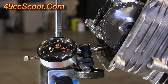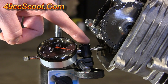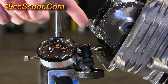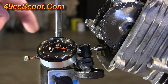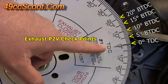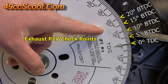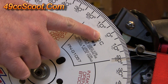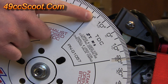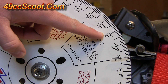After you finish the first valve, set up your dial indicator on the opposite valve. I've set up my dial indicator on the exhaust valve the same way — on the spring retainer, keeping the angle similar, making sure the dial indicator has room to travel with the valve. For the exhaust valve, I'll be checking between zero degrees top dead center and 20 degrees before top dead center. When doing these checks, follow the direction of engine rotation — so rather than going from zero to 20, start at 20 before and move back to zero the way the engine rotates.